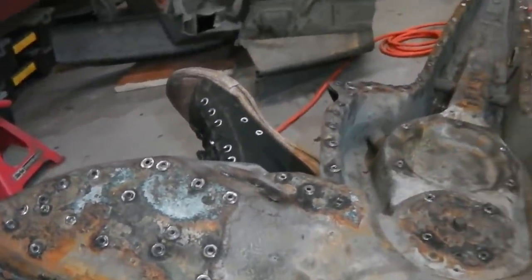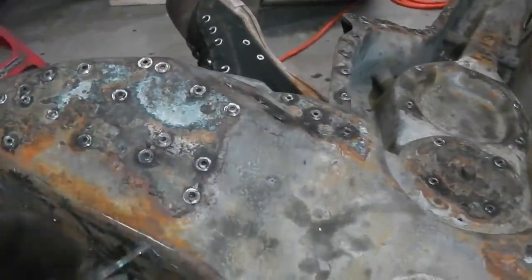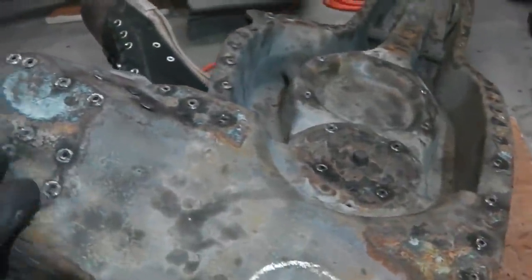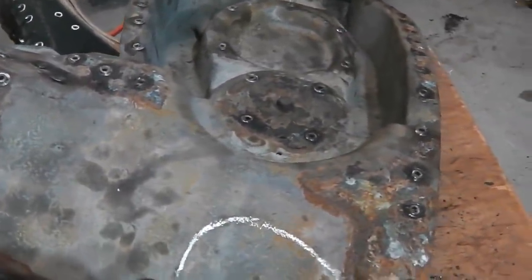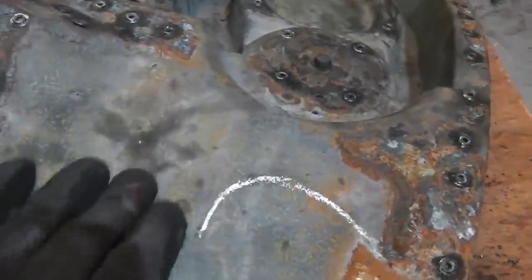It's very important to have your pilot drill bit. That's a real game changer. Everyone's piloted, because otherwise this will dance all over the place. So you go for your spot welds. The biggest error that I find is you'll miss a spot weld. So you'll have sanded them down, or you rub the lead gently. Like for example here, if I rub gently, watch, look how they've appeared.